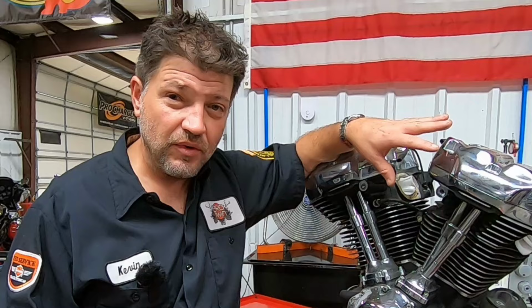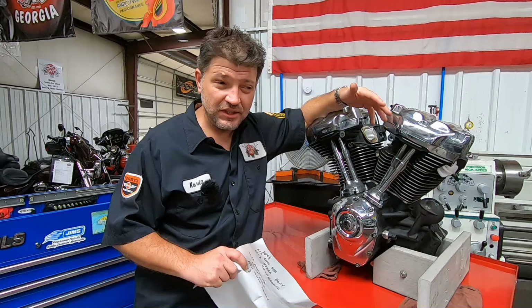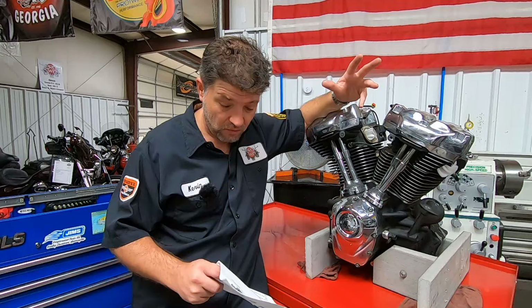What I'm getting at with all this is we really don't know if this thing's sumping. There are a lot of clues that can lead to sumping and varying oil levels, that sort of thing. Also, a loss of power, which he didn't say he noticed a lot of, other than intermittently. An excessive reduction in fuel economy is a clue that the engine is under excess load. So that could very well mean this one may be sumping a bit too, but it's primarily the really loud noise that is why we're going into this one.